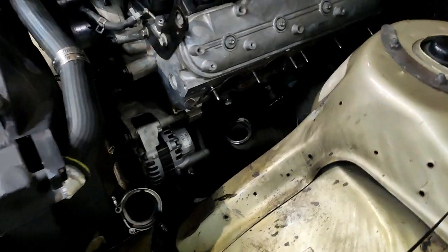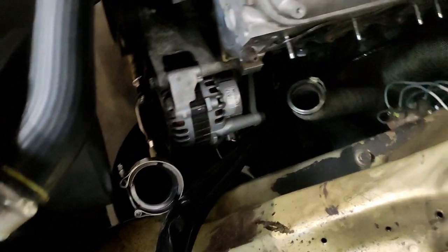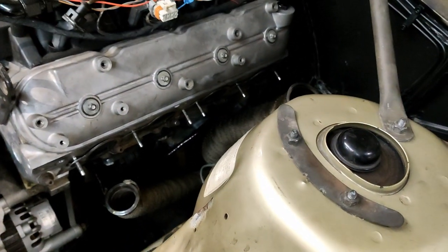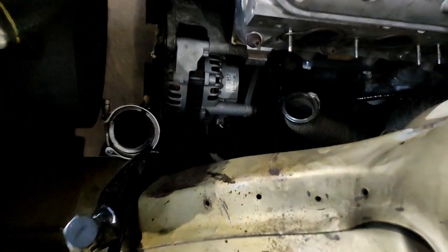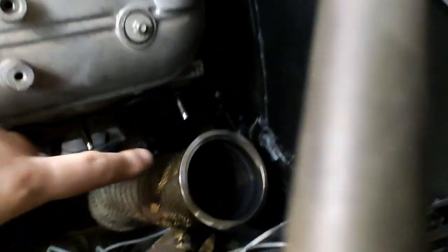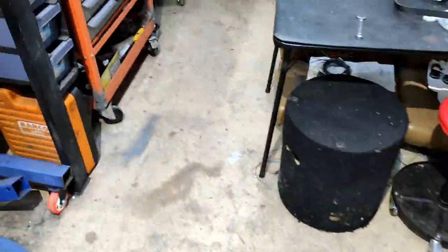That was a success — it is possible to get the manifold off without removing the crossover pipe and the dump. I've just let the wastegate pipe drop down, wiggled it out, and stood all the studs in. As for what's leaking: everything. That v-band leaks, that v-band leaks, and it's leaking from this port which is pretty obvious on the pipe.